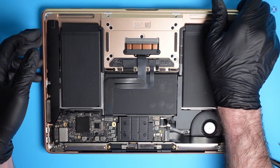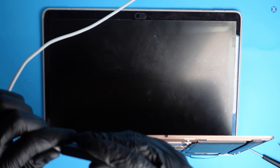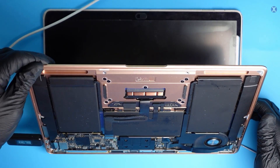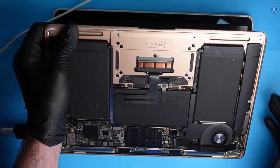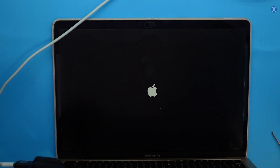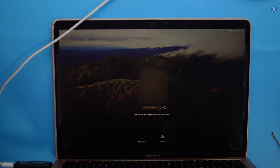We've got it plugged in, so let's try it out with our USB-C tester. We're getting 20 volts, 0.28, 0.25, 0.5 amps — looks like it's turning on. It's at one amp, fan spin over here, and we've got a backlight too. It's very bright. So the backlight works, and that one cap was just a redundant one.